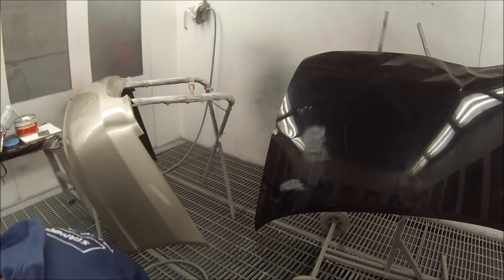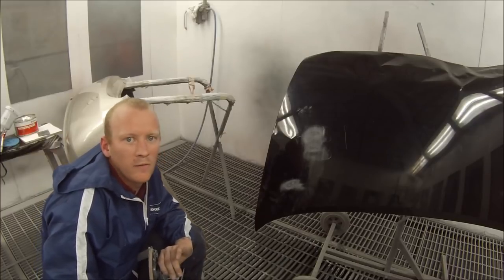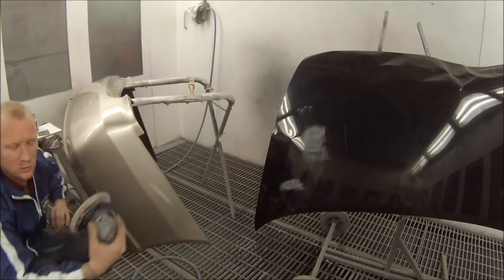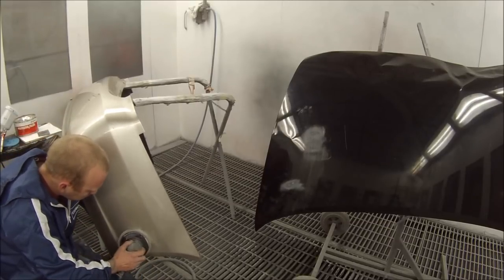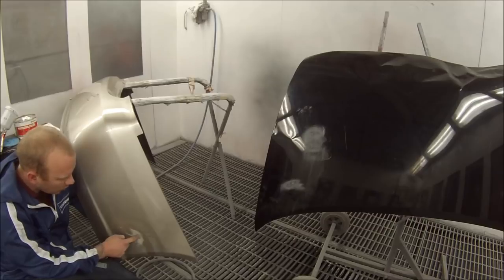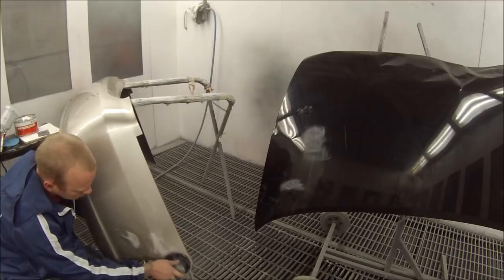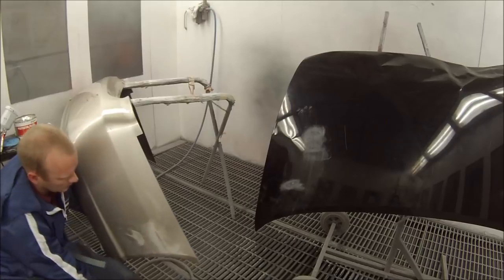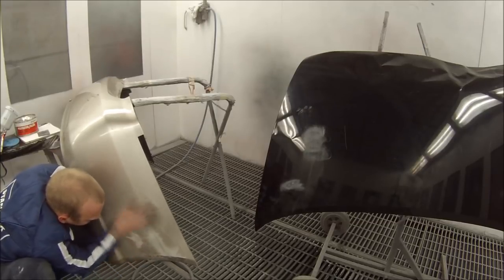The main reason I made this video is because I saw a guy on YouTube doing things I would never do, and I wanted to right those wrongs and teach people how to do it properly. See how I was holding that up on an angle? Going from the top of your paint right back out of the plastic in such a small area is going to leave a low spot. This is the correct way — holding it straight so it feathers down through the area. That other way left a low spot.